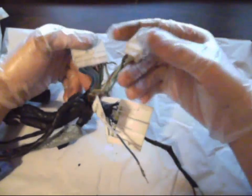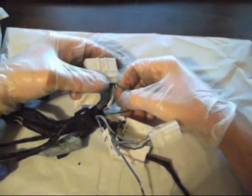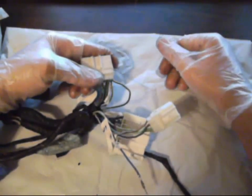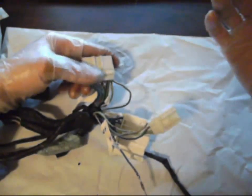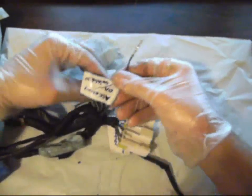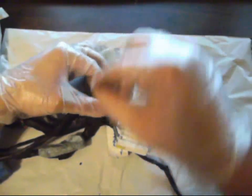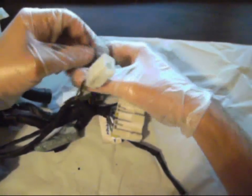Second, you need to run the blue wire with a red stripe on the small 7-pin plug. It needs to be run to ignition on. You can tie this into the blue and red stripe wire on the blower motor — it's the easiest way to do that. That would be this wire right here. I de-pinned it and marked it accessory on, or switch 12 volts.